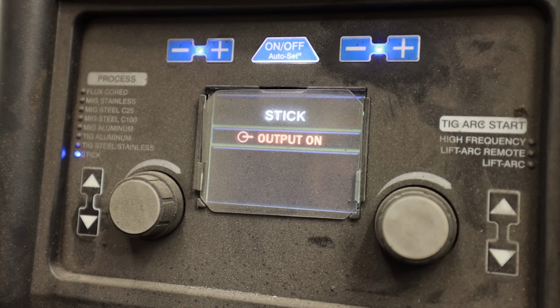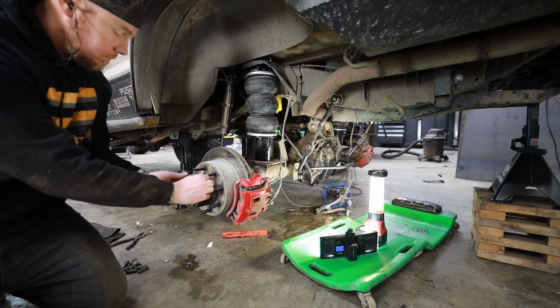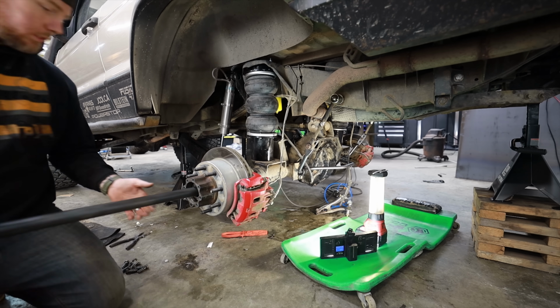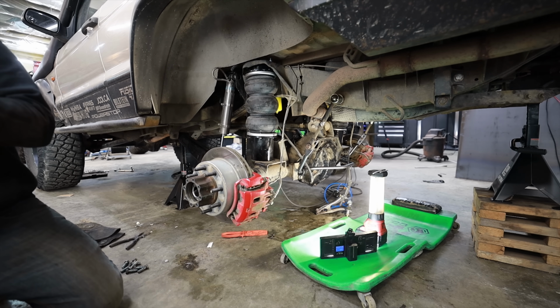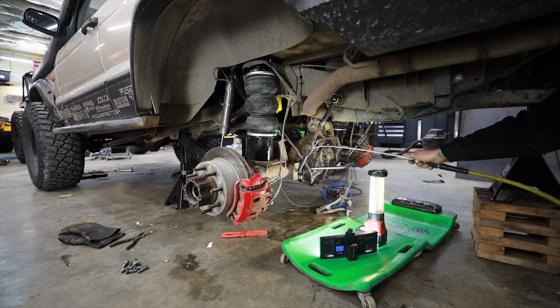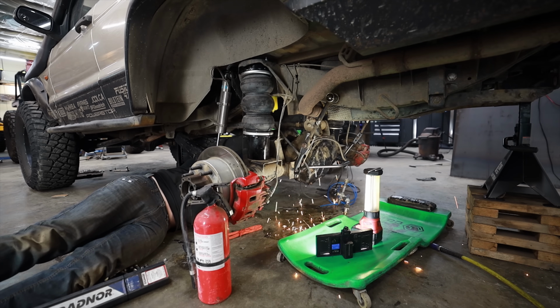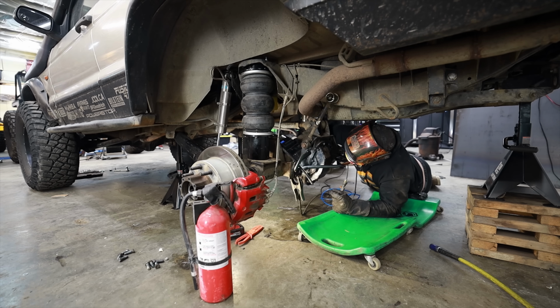And then I really wanted to use a stick welder because the welding rod that I have would be pretty good for a dirty weld like this, something that might have a little bit of paint on it, maybe even some of the soap and water residue. But without being able to see it, I could not get the stick to work the way I wanted to. I'm not good enough at stick welding that I could do it completely blind. However, I am good enough with a MIG welder that I can do it completely blind.